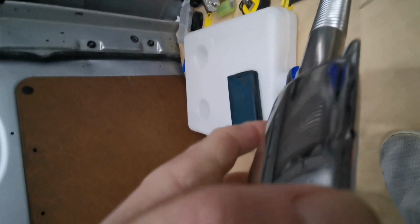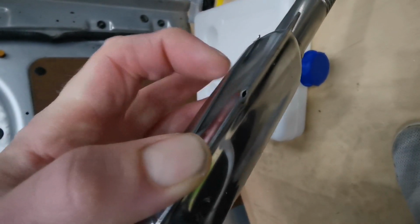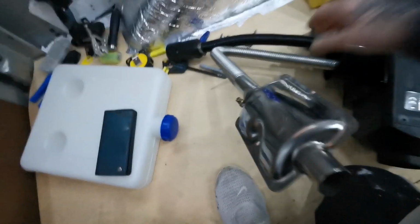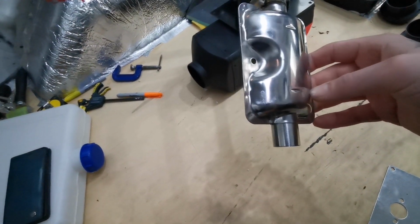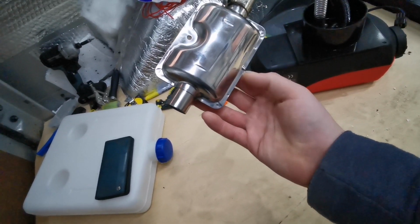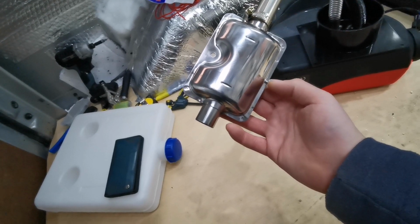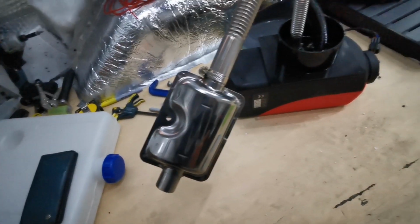Stop moving. There you go. The little hole there, and that'll just release any fluids in any way. Because you hear a lot of people online saying the exhaust is making some sort of bubbling sound, and that is because it's upside down and this hole is actually at the top. So you always make sure this is at the bottom. Okay, all good. So that's set up now.